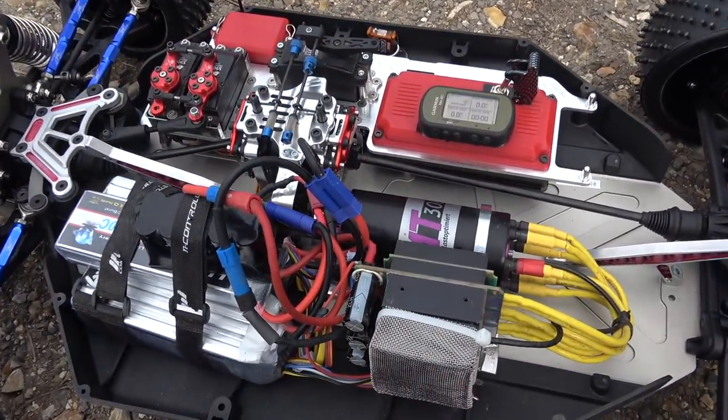Right, so a quick word of warning for you guys. This does not run as it should. We had a couple of issues here, or Mike had a couple of issues here with the setup of his 5T, and although it's on 15S, it ran, or it looked like it ran slower than 12S, to be honest. So we're thinking that it's the settings on the MGM, or that's what we're hoping. He's not actually ever fiddled about with the settings, so anyone who's got one of these MGM controllers and this setup with this motor, maybe you can add some light to this.